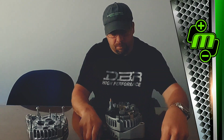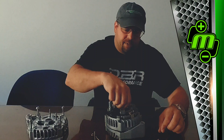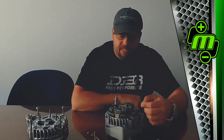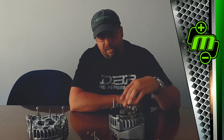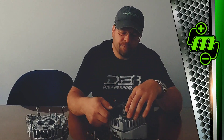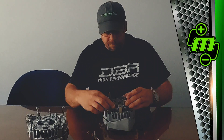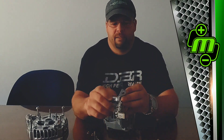Generally you'll have four bolts that hold your alternator together — the two halves. Take everything apart and we can move it around as we see fit. This is the regulator out of my 2008 Silverado; we've tested it, beaten on it, tried weird things with it and can't break it. The regulator is still here because it's still soldered in. So say you need the output stud in a different location — before we build it, or if we've already built it, we unsolder it and move it. You can see it's a pressed-in stud.